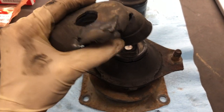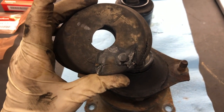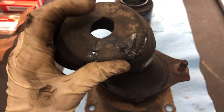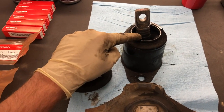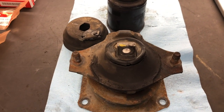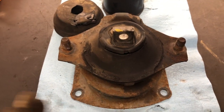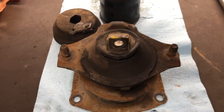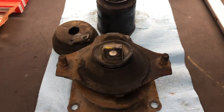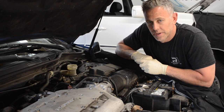There's also a dust cover here — I pointed out it was cracked. You can see the print from where the bracket was resting on it, which was causing you to feel everything the engine was doing inside of the car, because there was nothing separating the engine from the mount on this one. The engine was resting on the metal, the metal is connected to the frame, so you felt everything inside the car. So if you're feeling a rough idle, the engine appears louder inside the car — not an exhaust leak, but it just sounds or feels louder — transmission shifting hard between gears, or you hear a thumping sound when taking off from a stop: your most likely cause is an engine mount. Those two quick, simple checks are how I determined the engine mount failure on this V6 Honda.